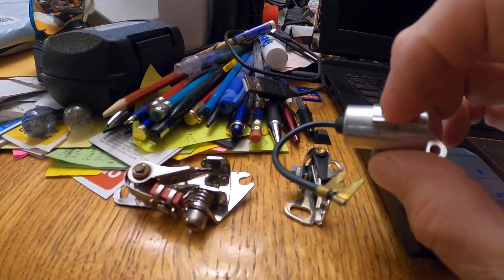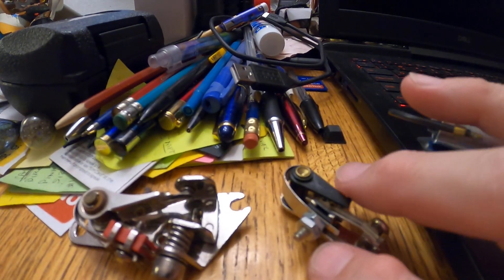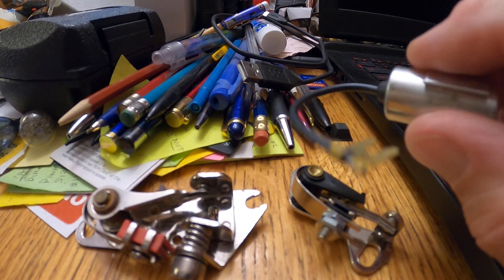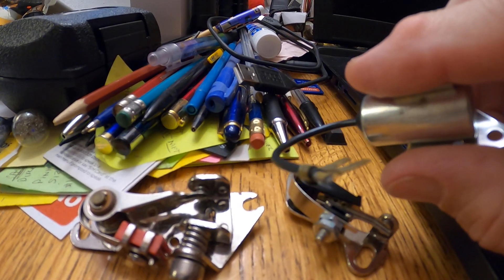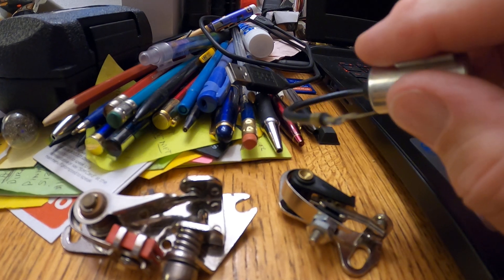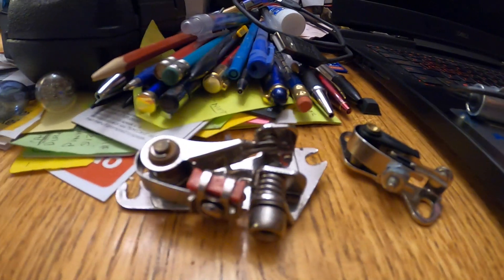The condenser was plugged in right here on the contact with the wire going to your coil. Every time the points would open, the condenser made sure they didn't arc and pit — well, it would arc to an extent because that's what would wear them out. You'd get maybe 15 to 20,000 miles out of a good set. Sometimes the condenser would fail, the points would pit, and the thing would stop running. That's just something you had to do routinely on the old cars.